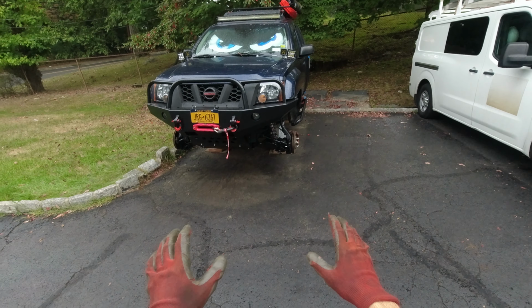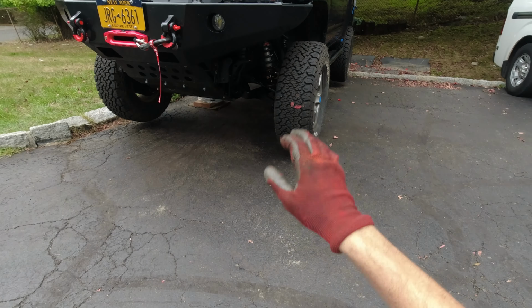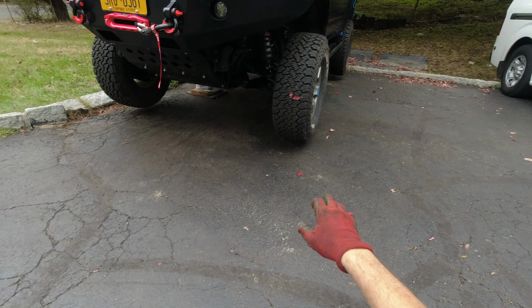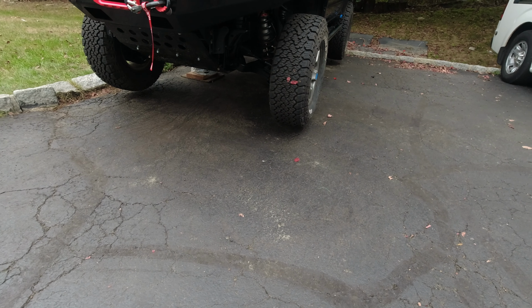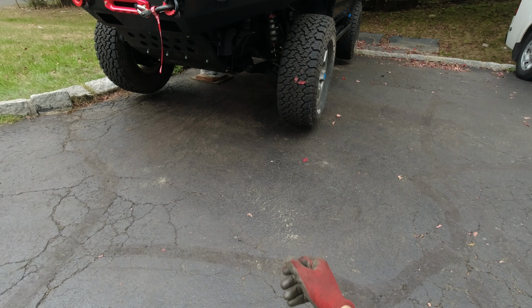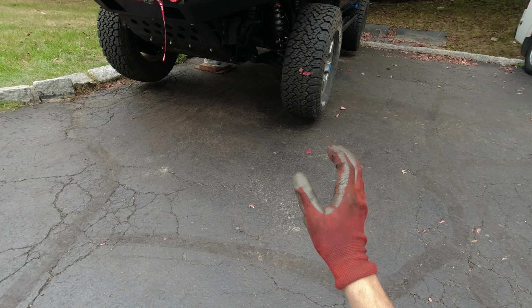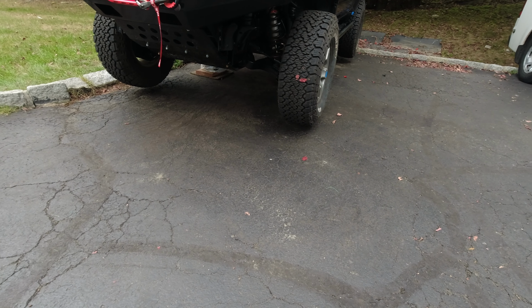So now I can put my tires back on and I can lower the truck. Right, all the tires back on. So now we can safely lower down the truck and bolt the lug nuts to specs, which is 100 lb-ft of torque. And we're done, and we successfully did our tire rotation. It's recommended to do a tire rotation between 5,000 to 7,000 miles. It was pretty much my due time to do the tire rotation, so might as well do it right now.